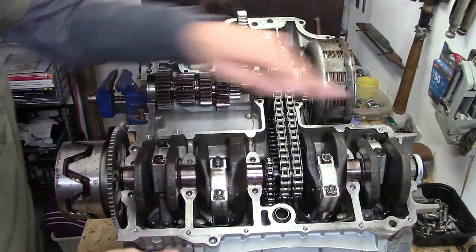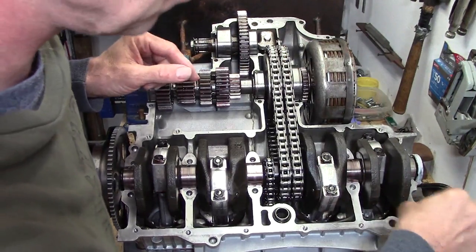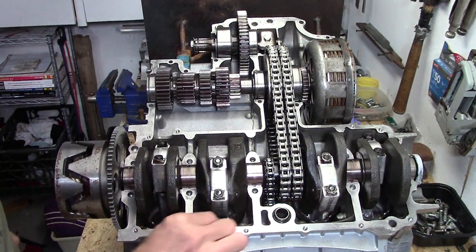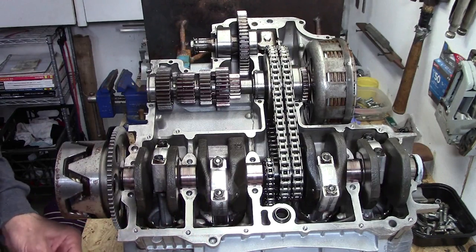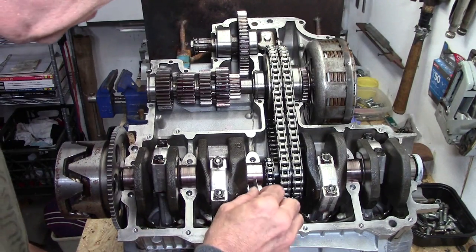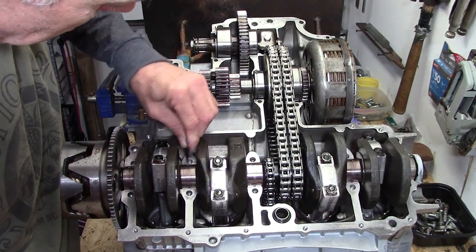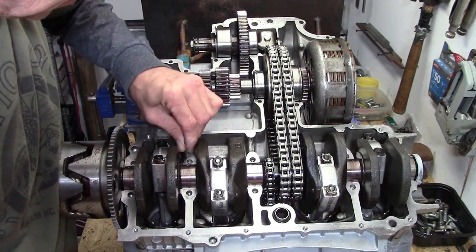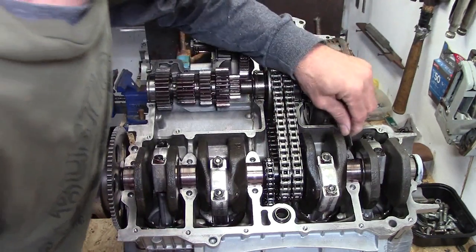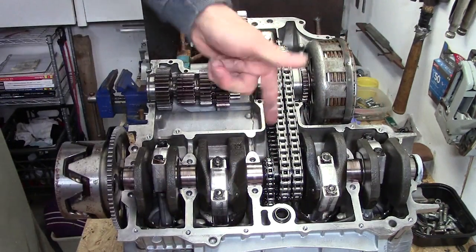That little bit with the Honda Bond on that seal — that's actually optional. That's just me being a little bit cautious; I want to make sure that thing stays in place. Now I'm going to take a single-edge razor blade and just scrape any leftover sealant or bond there may be on here. I want to get a little bit of Honda Bond in some of these places because it's mostly going to be there to seal up that area — it could work up through the bolt and leak out.